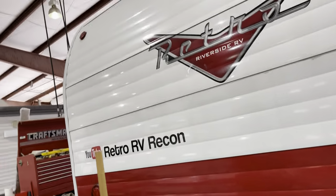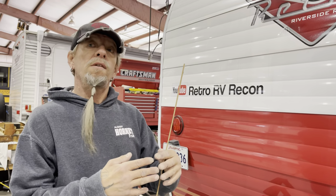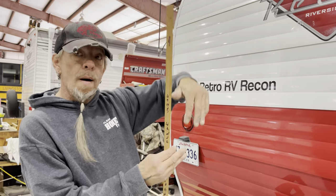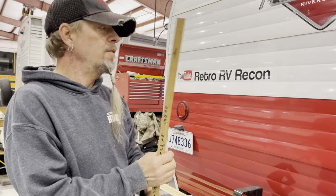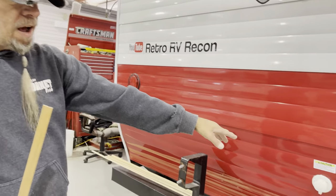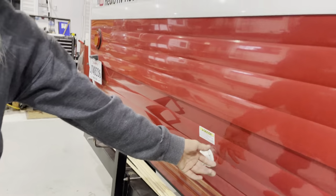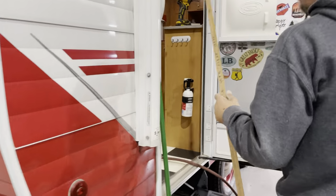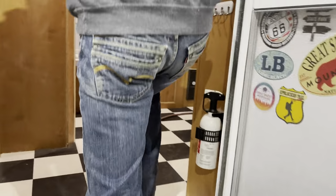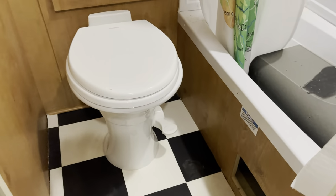And the thing is, that OSB, like we were talking about the other day, being particle wood, wicks water. Water will travel up a wall. Oh, wow. Defying gravity, because water wicks into the fibers. Another possibility could have been a loose connection either on the inside where it connects to the outside outlet, or on the inside where the water supply comes into the toilet, where there's a fitting right there in the very back. I think that's where we first noticed it, behind the toilet.